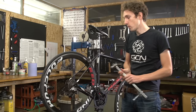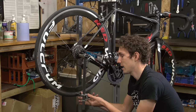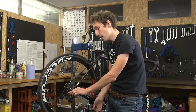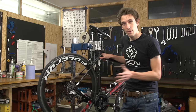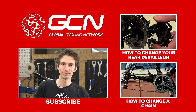The final thing to check — and it crops up quite regularly — is the alignment of the rear derailleur. Have a look from behind and make sure that the derailleur is sitting straight. You can do it by eye, but the best thing is probably to head into your local bike shop who will, in all likelihood, have a tool that checks the alignment for you. So that's your gears indexed. Remember to use the barrel adjuster — turn it anti-clockwise to move the derailleur inboard and clockwise to move it outboard. Check your cables first, then look at your chain and cassette for wear if it's jumping after you leave the work stand. Also remember that swapping wheels might move your indexing out of line, and check the alignment of your rear derailleur and the mech hanger as well.